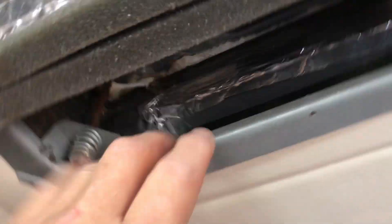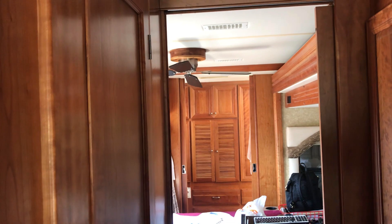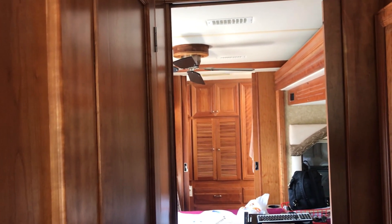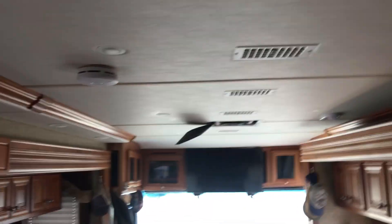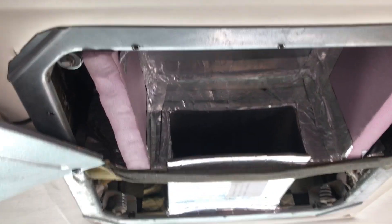This allowed all the airflow from the blower fan to go into the vent and all the way back to the bathroom — the difference was tremendous. It used to be that you couldn't feel cold air in the bathroom when the AC was on; now, you could be sitting on the toilet and it would mess up your hair. We're cooling that back area much more efficiently, and the same improvement applies to the front.